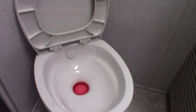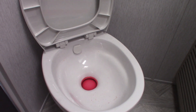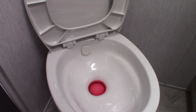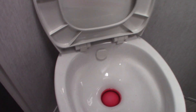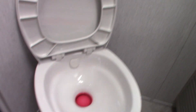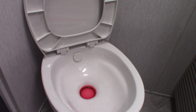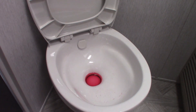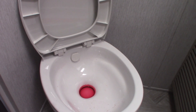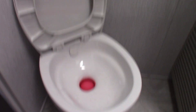The toilet is typical — it has a flush pedal and sits right over a black tank, so you can't use it dry. When you get your water and power hooked up, you'll come in here and put a dose of chemical right in the bowl. Then you would stand on the pedal long enough to put at least a gallon of water in the black tank along with the chemical. Then it's ready to be used. If you don't do that — that's considered using it dry — and it will get clogged up and smell terrible. So you always want your chemical and water in there before you start using it.